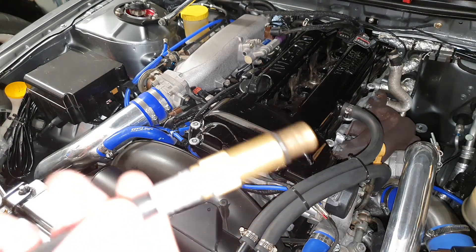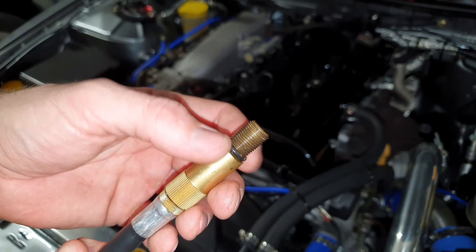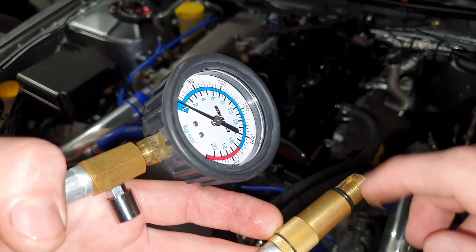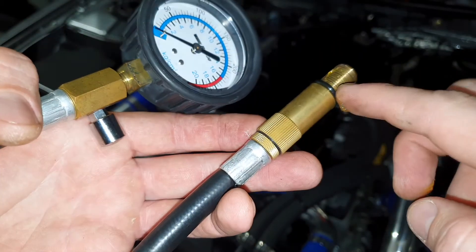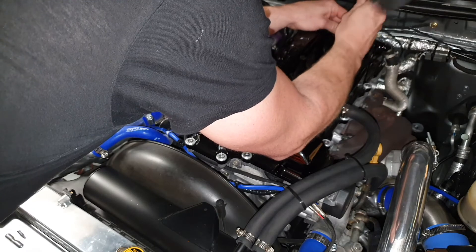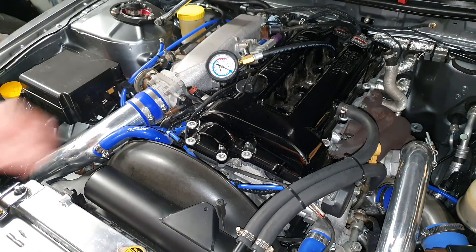I think I may have discovered why it's low though — I'm hopeful. See that crud, the rust on the O-ring? Maybe it just wasn't sealing properly. I've just cleaned the spark plug hole out and I'm putting a little bit of grease just on the O-ring just to make sure that it's sealing 100%. It's not wet down in there — it's dry, which is a good sign. It's possible one of the valves isn't seating properly. We'll give it another shot.